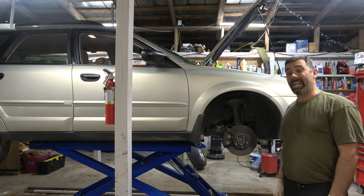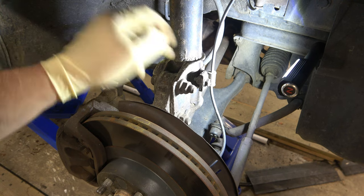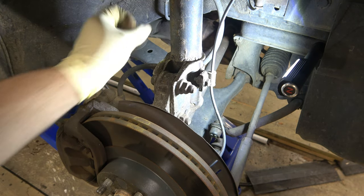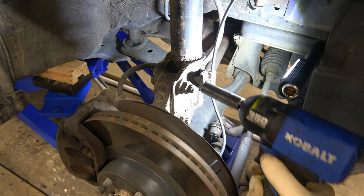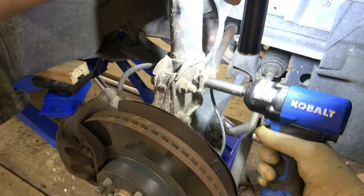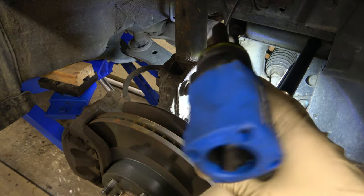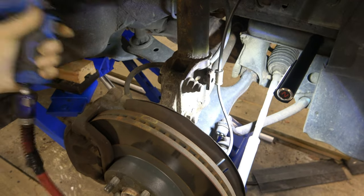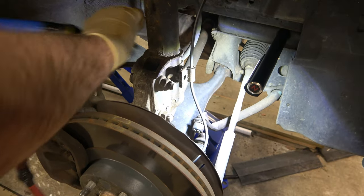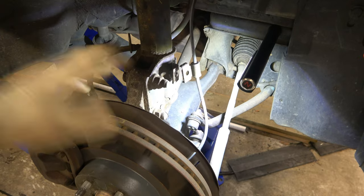Let's move the camera in closer and take a look at what comes next. The first thing you're going to want to do — this is a 12mm and that's a 12mm — you're going to remove both these bolts here, and that's going to free up our brake line and our ABS line. I'm using air tools for all this just to speed the process up, but it totally does not need air tools in order to do this job properly.